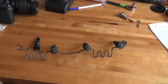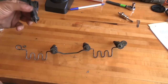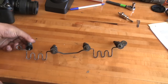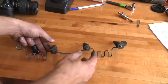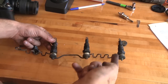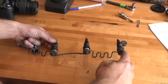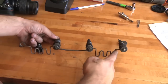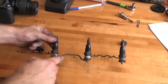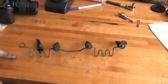Here are the original glow plugs, and I wanted to show how they were mounted in the engine. The engine is from a 1976 Mercedes 240D diesel — four cylinders, four glow plugs. This one was really hard to get out and I broke the tip right off. Normally the way these work is they're all in series, so they go from a wire to this one, through the little loop and around back, through the resistor wire, through the loop and around back, through the wire, through the loop, around back — and then just at the end this one was grounded to the engine block.